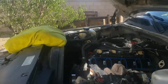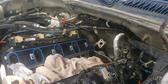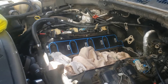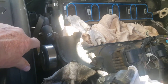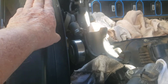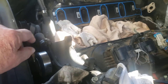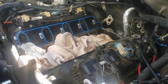The odyssey started in Oklahoma when the check engine light came on, and the code gave a reading for the camshaft position sensor. The camshaft position sensor is right down here underneath the tensioner, so once you remove this it's pretty easy to get to. I replaced that, but I was still getting a backfire.